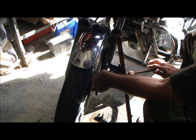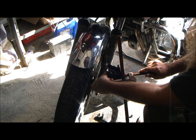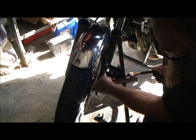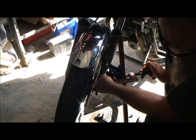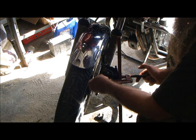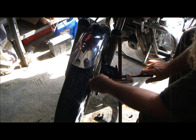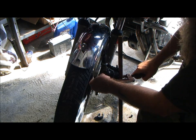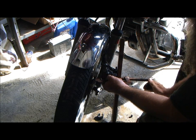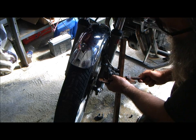Okay, so I'm squeezing it back, and I should mention, if you're doing a Yamaha or a later Honda and that hole pops with pressure, you might want to have your cap over your reservoir, because I have seen these just blow. Which is why I wear glasses when I do this, because I have had a couple of master cylinders that I couldn't even save this way.